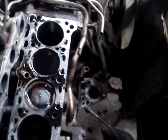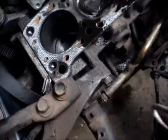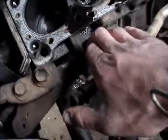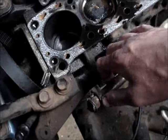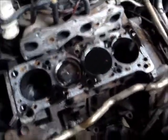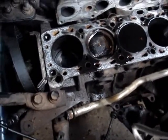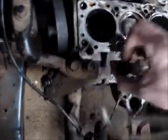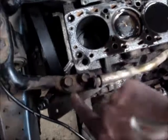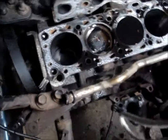I found the reason why the head gasket's blowing, which I'll show in a second. This water pipe that goes down to the thermostat housing was a bit longer - it's a steel pipe, a rubber O-ring goes on it and then it just gets pushed in. The bolt off the exhaust manifold holds it in. That's rusted away, so someone packed it full of silicone and jammed it in there and tightened up the bolt. I'm going to fix this pipe by soldering a bit of household copper pipe onto there and fitting it back as normal - shouldn't have a problem.